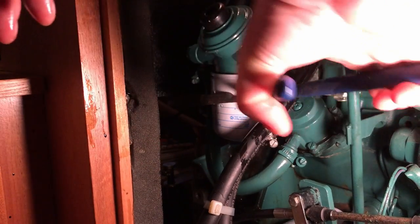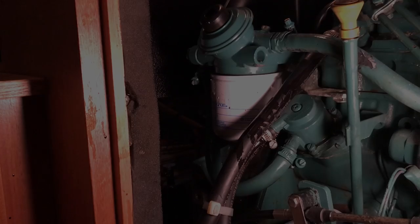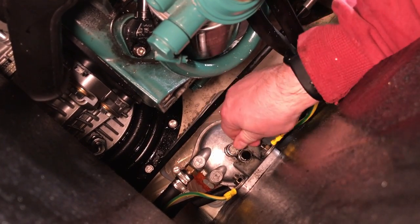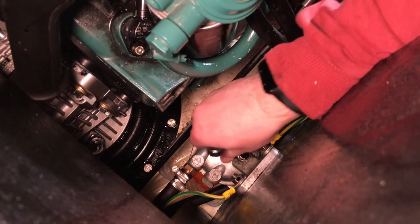This one's got me airtight, so it's a good idea to make sure it's on properly. That's the easy one done, and now for the slightly more difficult one. Access to the pre-filter housing is restricted, to say the least — it's a 13mm nut on the top which I almost have to do blind, but we get there in the end.